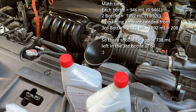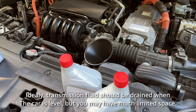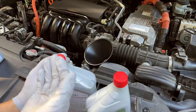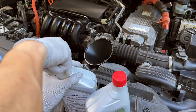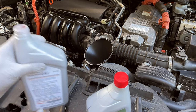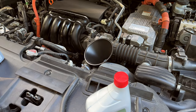The car is still on the ramp. At the end I'll put the splash guard back, lower the car, and add the remaining amount on a flat surface — I think for a transmission change it's better to do it on a flat surface. Don't forget: next time also get a brand new crush washer. The new transmission fluid is bright red, very bright compared to that really dark old fluid.